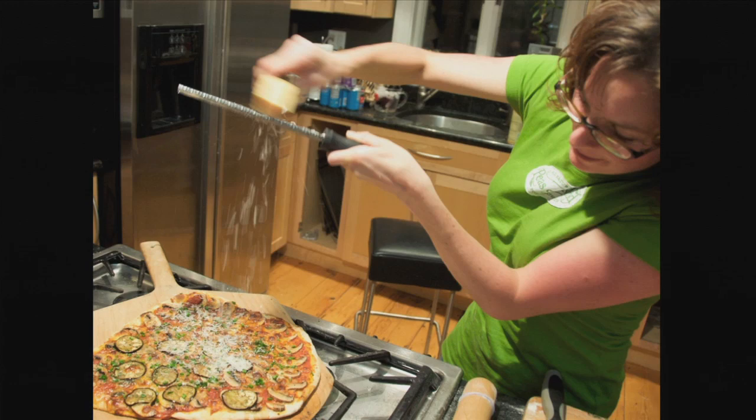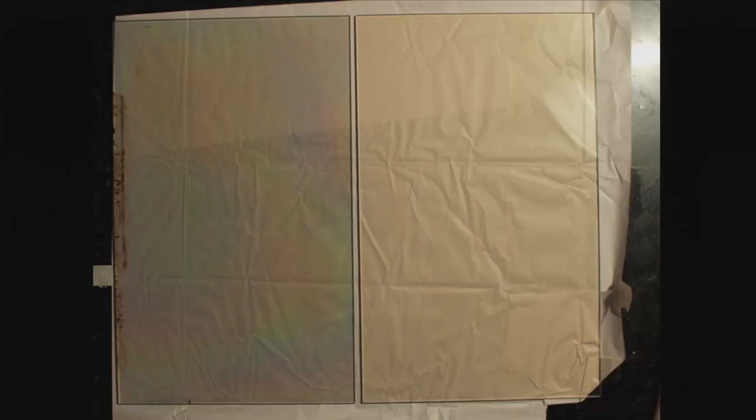The downside is your oven's really not designed for this. One of the two glass layers is the original painted glass; the other is something called Pyroceram 3 — it's quartz crystal, what they used on missile nose cones in the 1950s, heat-rated to a much higher temperature. My oven broke — a little bit of sauce fell off the pizza and hit the glass, and the glass just broke. But it's truly amazing what you can buy on the internet — I found Pyroceram 3 and got someone to custom cut it, and it was cheaper than the replacement part from the manufacturer.